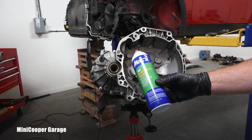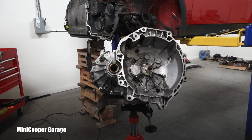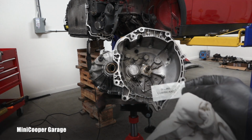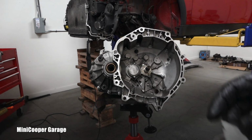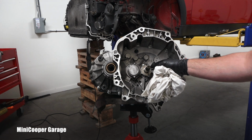Now, using brake clean and protective gloves, right? I brought this whole thing to the level where I feel that it's satisfactory for installing the new part. Also, note I removed the old grease which was here on the shaft. All these sets always come with this high temperature grease, right? Which you will be applying in a very small amount in this area.